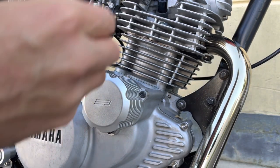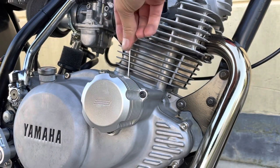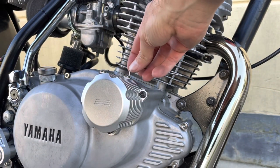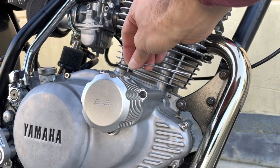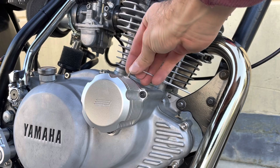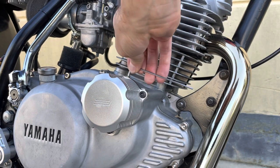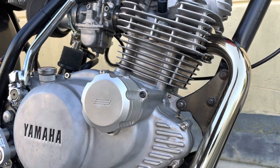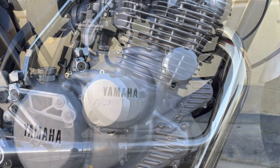And then don't forget to do up the air screw here, which usually on this one has a very small gasket because we've got a small screw, and on the standard one you also have a copper gasket which seals there. So just button that up, and we're done. That's the oil filter change, and then we'd actually fill it up with oil, but we're going to do a few more processes before we get to that point.